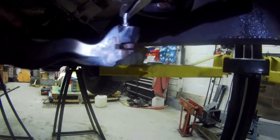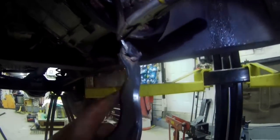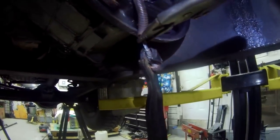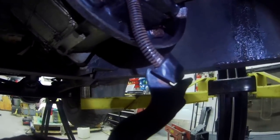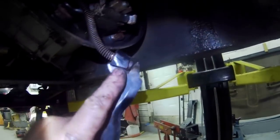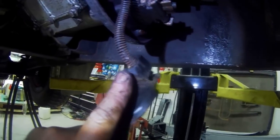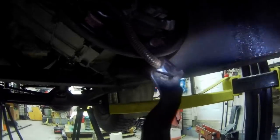So this is the cable fitted now to that lever. Perhaps you can understand now why I had to push the spring up, because you've got to hook this piece in. And this end here is bent over a little bit, so it's not a straight parallel drop in — you've got to sort of hook it in, and this is the reason why I can't video it at the same time, it's very difficult. When you take off the vice grips, the spring will push forward and keep that in place. I just wanted to note that. It would be so much easier to do this on the bench, but this is real time — this is what we do. So next step is really putting the shoes in.